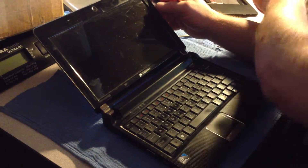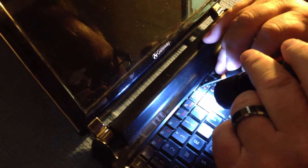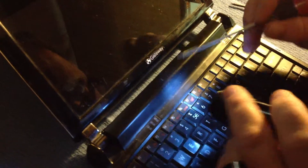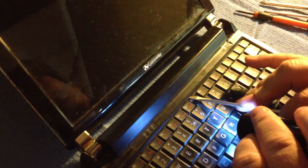Done a little digging around with a little better light along each corner. And then right above the F8 key, there's a small plastic tab that pretty much you just have to push in and get underneath it. Right up here you'll see there's a tab — push that in, and that releases the top half of the keyboard.